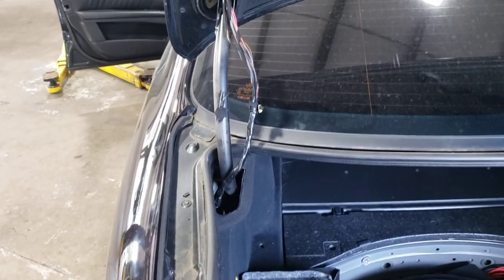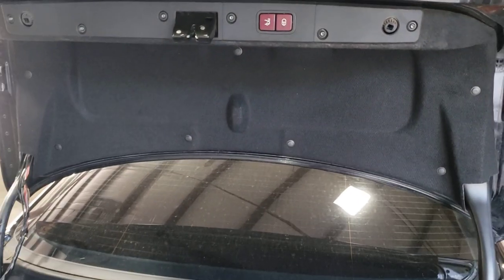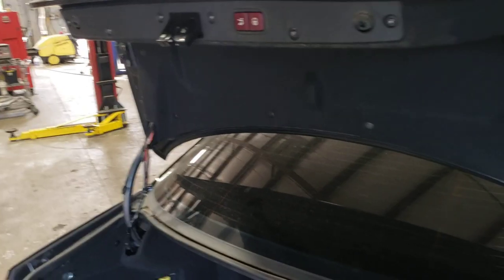This will cause all sorts of trunk issues. I think there is even an antenna in this trunk — if you have GPS, there may be one located here. It'll give you all sorts of faults if one of these wires breaks. Especially the ground — a broken ground will kill pretty much everything on here.